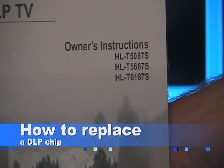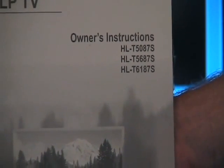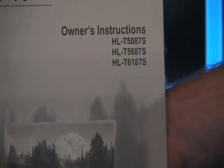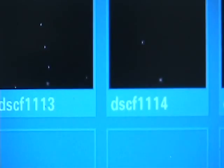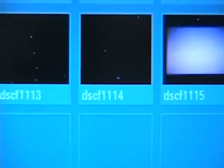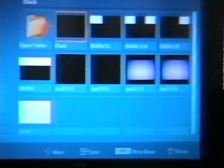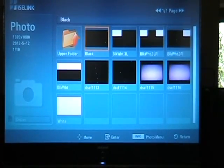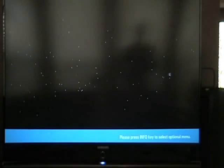This is a video tutorial on how to replace a failing DLP chip on the Samsung HLT6187S. You'll know your DLP chip is failing when you start to see always-stuck-on pixels. They're easily evident if you look at an all-black or all-white picture — you'll see stars or lights that don't go away. That is dead pixels on the DLP processor chip no longer functioning correctly.